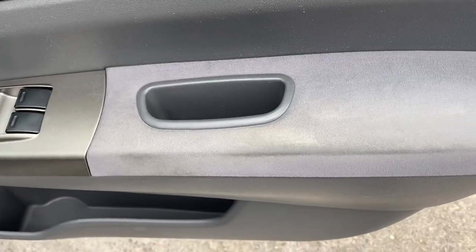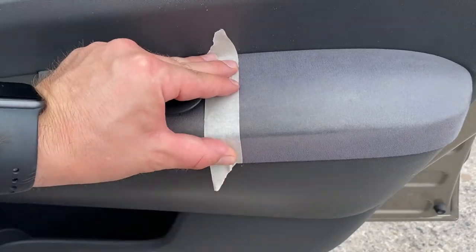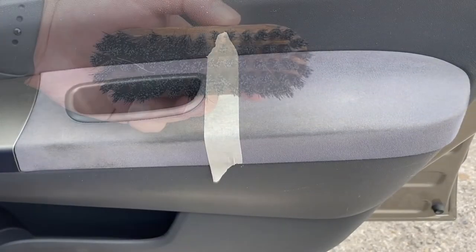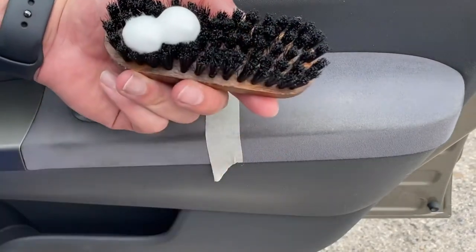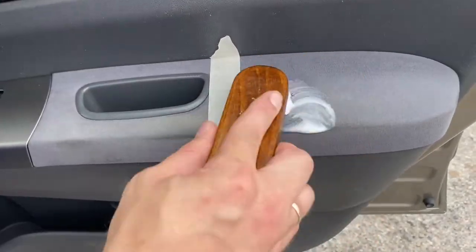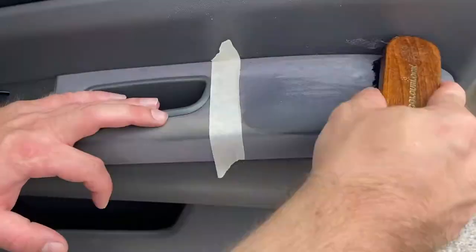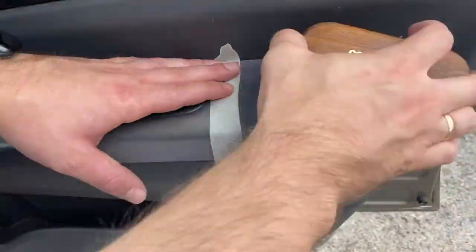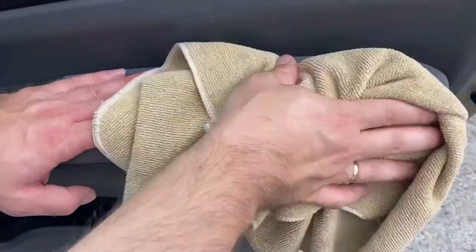The fabric beside the buttons on the driver's door is one of the dirtiest parts of the car, so doing a 50/50 test here will give a rough idea of what this product is capable of. I used a color-lock leather and upholstery brush and found that a little product goes a long way. The instructions are straightforward: clean with circular motions and on the edges use longitudinal motions, then simply wipe off with a clean, dry, absorbent microfiber cloth.